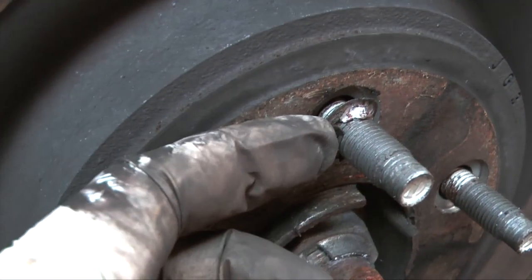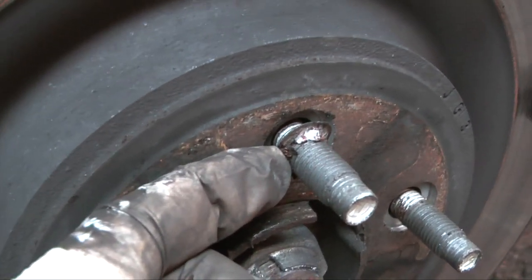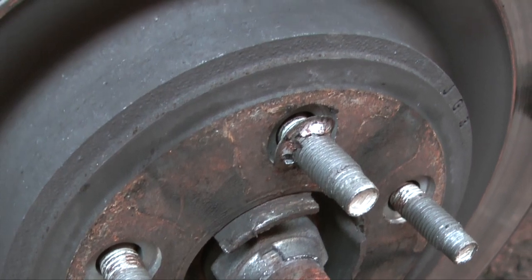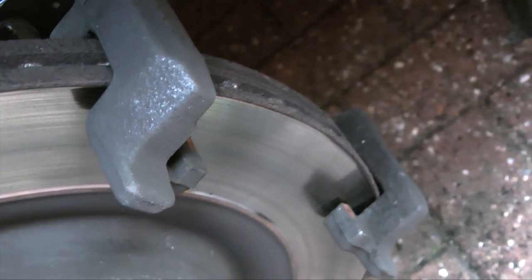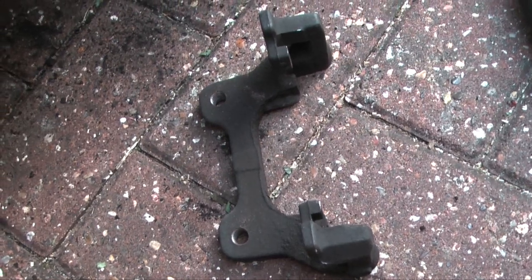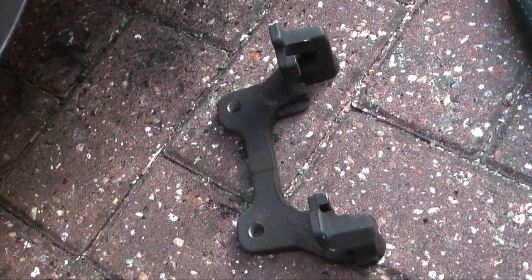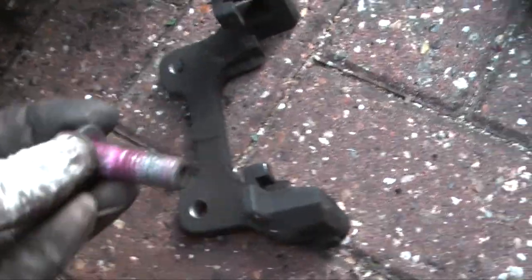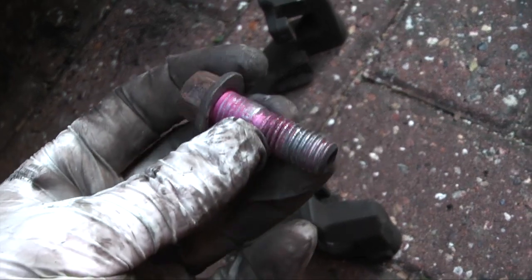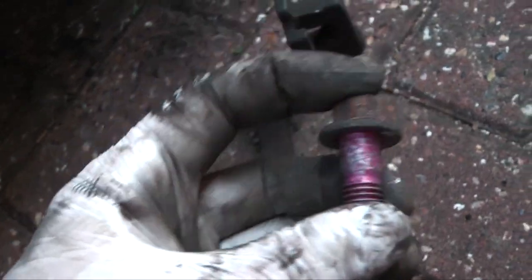The discs feature a couple of small retaining washers. Use a screwdriver and long-nose pliers to pinch them off, hammer flat, and reuse — they're just for convenience to hold the disc on the hub during reassembly. The caliper shoe carrier needs to be removed with a top and bottom 15mm bolt, which may be stiff as it's torqued significantly higher than the slide pins. Jaguar recommends replacing these bolts completely — they're marked red because the torque is critical. Apply thread lock to make sure they don't come out, or you'll have a serious problem.